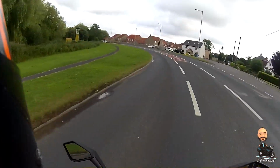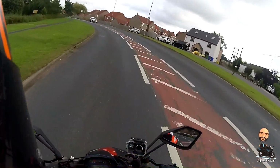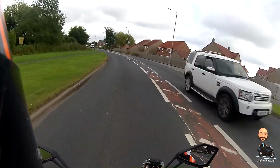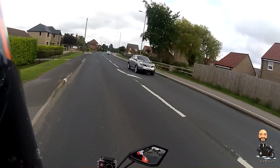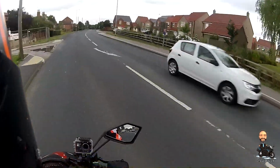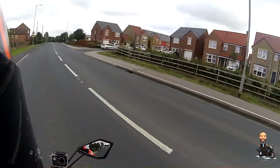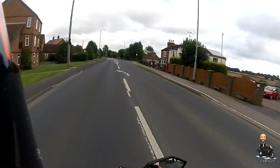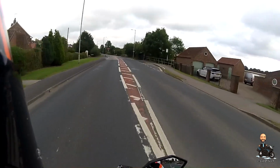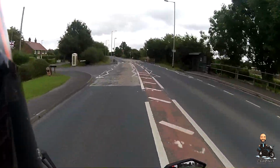While I was going over the bike, I checked out all the consumables and everything, as you do. And the tyres are starting to wear a little thin. Down to 2.6 mil. Legal limit in this country is 1 mil. I'm not sure of the logic of going down to 1 mil. That seems a bit like you could be pushing your luck. Maybe not in summer so much.